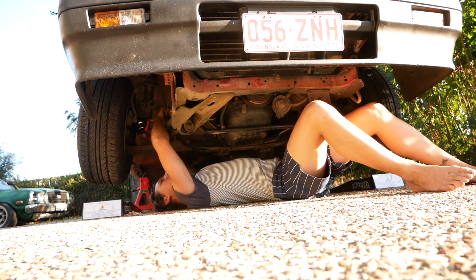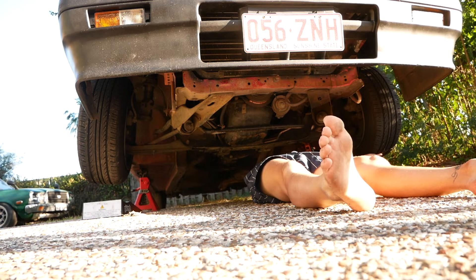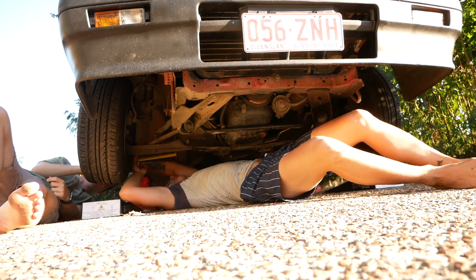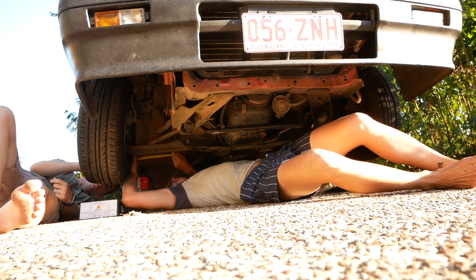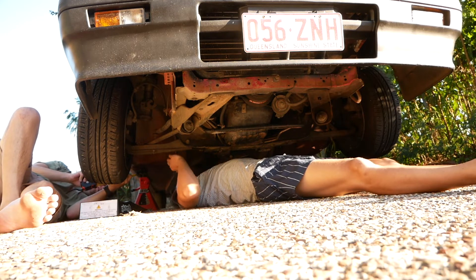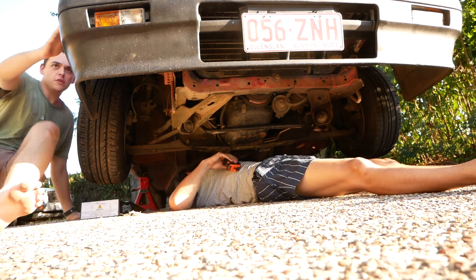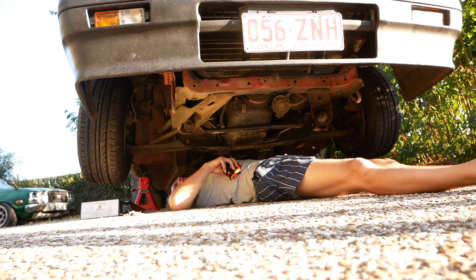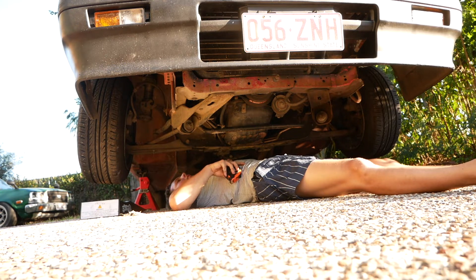That coilover sits 13mm away from the frame rail on the right-hand side and 12.5mm on this side. I definitely think the left-hand side has more camber. Measuring to the wheel — one side is 24, the other is about 28. That's quite a big difference. It doesn't look like anything is bent, which is really deceiving. Is it possible there are imperfect parts? Yes, possibly. I think I should just get the alignment done first before anything else. Four centimetres difference is quite a bit, but it doesn't matter right now — it's a figure to go by. Yeah, anyway, it is what it is.